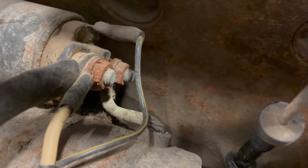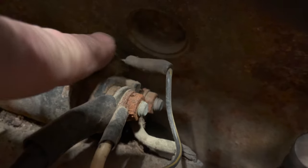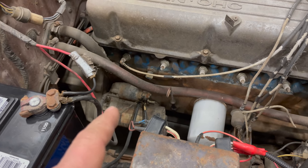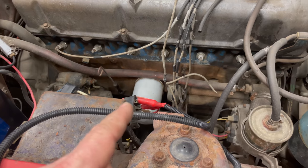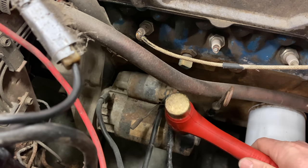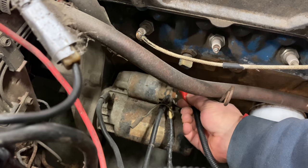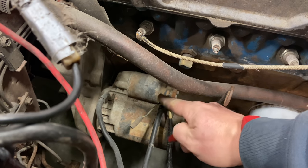This little wire activates the starter solenoid. I'm going to disconnect it and then hook up my alligator terminals straight to that so I can activate it from the engine bay. I'm going to grab a hammer and tap the starter while I do that — see if we can free the starter up. Now I'm just going to take my brass hammer and give the starter a few taps. There we go — it works now, it was actually turning the engine over. So I'm going to connect the wire back up and try it again from the inside.